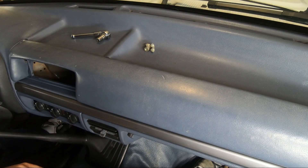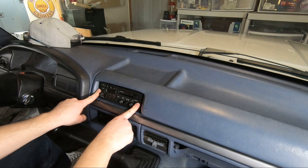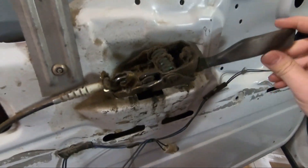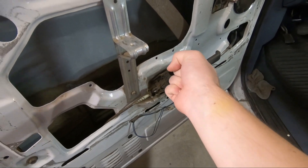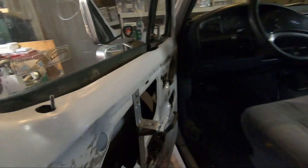That was the last piece of the puzzle for the interior — everything's done besides the door. Now the last piece of the puzzle is this door handle — you can see it's really really loose. See how that metal's bent up? It's not supposed to be like that. The metal is just so thin that after pulling on it over and over for 30 years it just rips and tears out, so I have to make a reinforcement bracket.